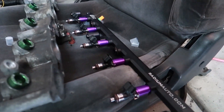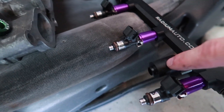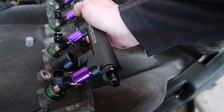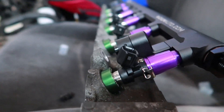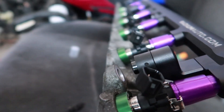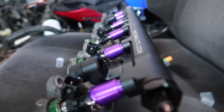Here's where I'm at. Got these injectors in. Took the spacers from the original rail. One thing I'm having a problem with — the spacer right there obviously isn't making it here, which it should be. So I'm not sure. I think I might need some bigger spacers. That's where I'm at right now, so I might not be able to do this today.